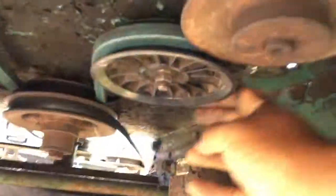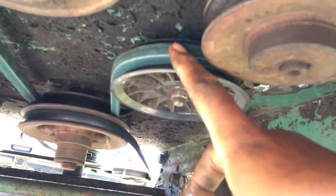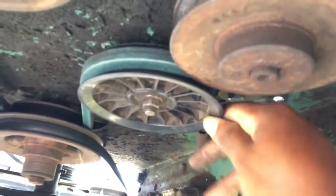It's that blue belt right there. I also put a new bolt on — the old bolt broke. I went to a regular hardware store nearby, got a bolt, put it on, and it's working just fine. It's tight but not too tight — I want it tighter, which is why I'm going to put a 46-inch belt on. Before this, the pulley right here was loose, and that's what caused the belt to break. The new bolt is making sure this pulley is no longer loose — I cannot jiggle it at all now.